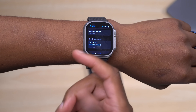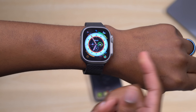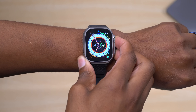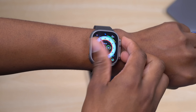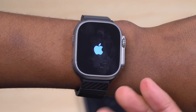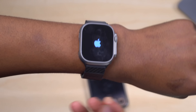There's a new way to force quit applications or force restart your Apple Watch. If an app is slow, jittery, or not responding, simply press and hold the side button and the digital crown at the same time for a few seconds. Your Apple Watch will automatically reboot, closing any stuck app and reloading all data.